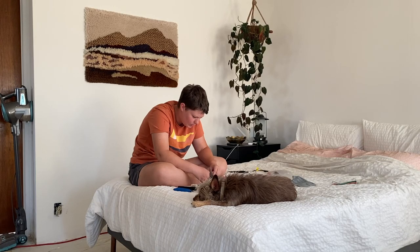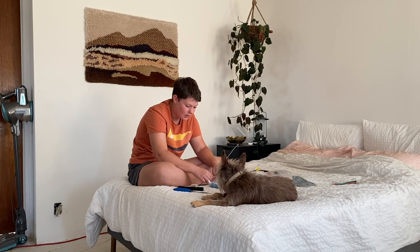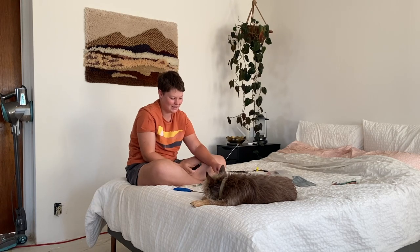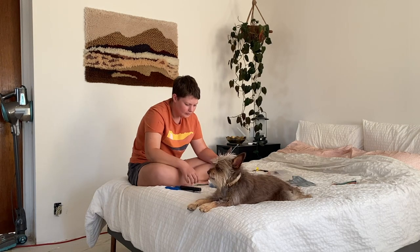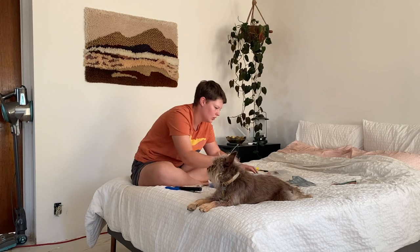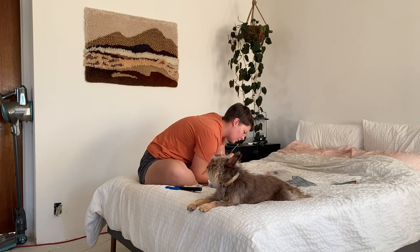The shitty thing about this project is that I'm putting wires together in two places, so for whatever reason, if things don't work, it's like, well, does it not work because of me installing that harness into the car, or because of what I'm doing here? That's not good, but it can't be helped. Cool. That's where I'm at so far. I just have red, yellow, and orange left. Power connection. Okay, so I have the option for battery direct connection for memory.